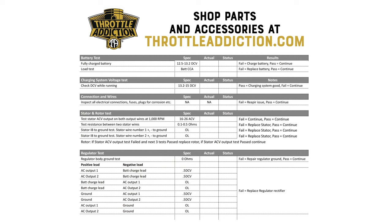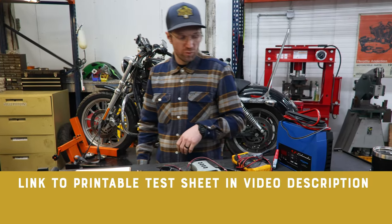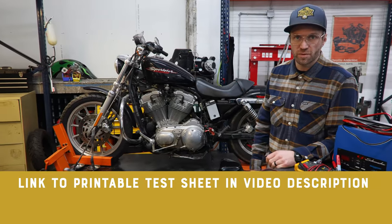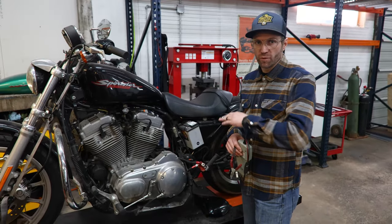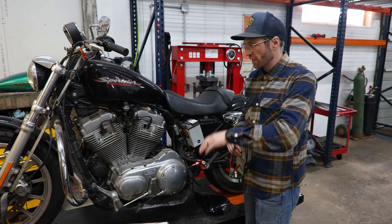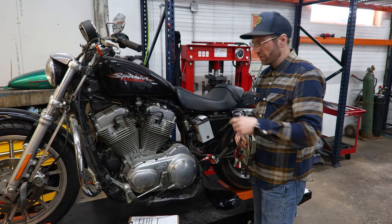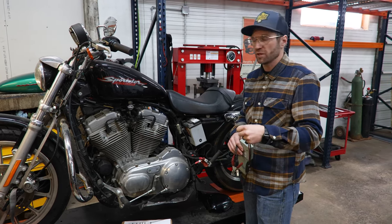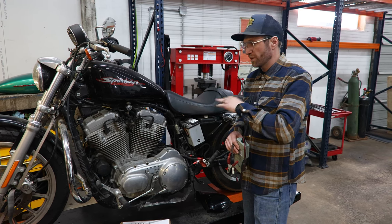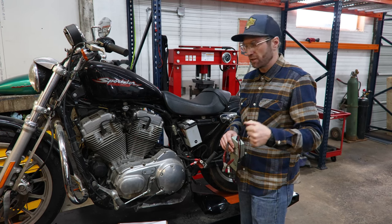There are a lot of different readings and a lot of different things you've got to do in the right order, so that sheet will take care of that. So with that, we are going to jump over and run you through this check sheet step by step and see if we can figure out what's wrong with this thing. The first thing we're going to do before we check or test anything charging-wise is make sure our battery is good. If we don't have good voltage, then everything else we test from there is pretty much worthless. That goes with any electrical diagnostics — the first thing you've got to do is make sure you have a good, fully charged battery.